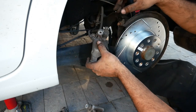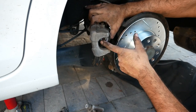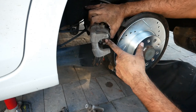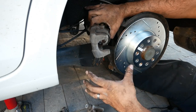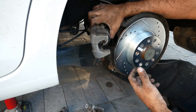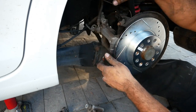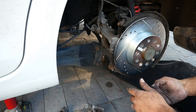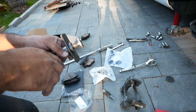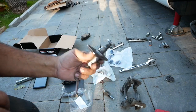You're going to need to go to AutoZone or your local parts place to rent a caliper tool. The rear pistons are not a push-type — they're a screw-type piston that ratchets in like a clicker to maintain constant pressure when the handbrake is on. We went to AutoZone and rented the caliper tool set, which just twists the piston and ratchets it all the way back in.